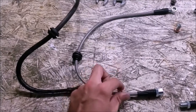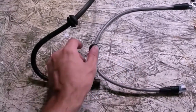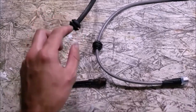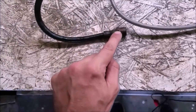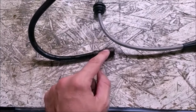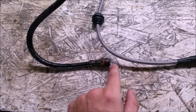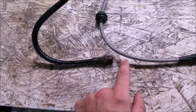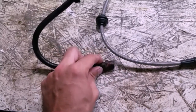Of course it is supposed to help with brake feel, though the biggest benefit is that these are just brand new brake lines. It's got the same little rubber area so it can be held in place by the bracket. You're going to be holding this still with a 17 millimeter wrench and using your 11 millimeter flare nut wrench to wind the fitting out, then pop this out of its fitting.